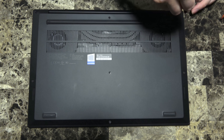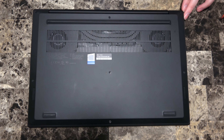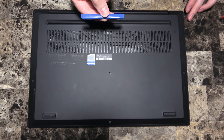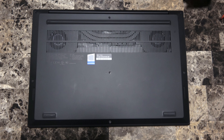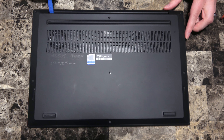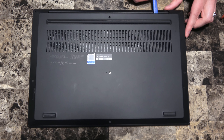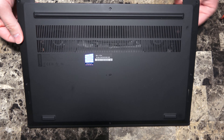I'll leave a link in the description for anybody who's interested — these are definitely useful to have on hand. I'm now going to be using a plastic spudger that was included as part of the ProTech Toolkit. If you don't have one, you could use a credit card or even your fingers if they're a little bit smaller. I'm just going to pry along the back edge, lifting all along the way. You'll hear it snap, but that's just the snaps coming undone from the backing. Once you have that undone, you can lift on the hinge side and then just pull the back towards you.